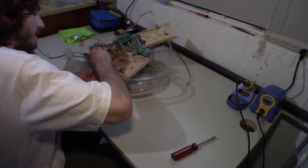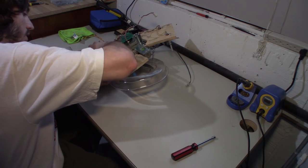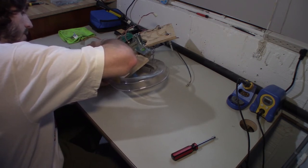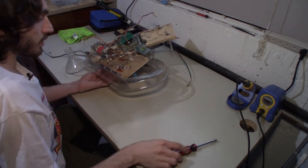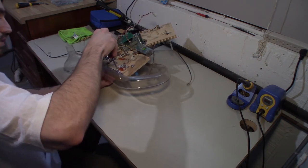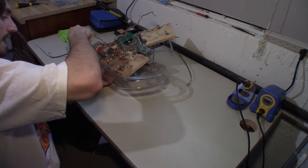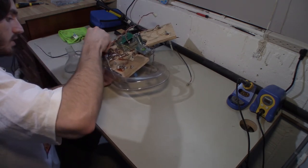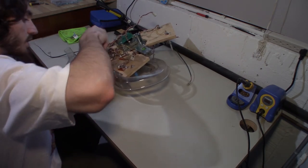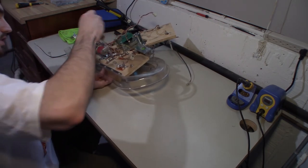And with all these ramps, I cleaned them all, washed them with soap and water, and then cleaned them and polished them with some Novus 2. So they're all in pretty good shape now. They aren't perfect, but they look pretty good. And the biggest thing here is you want to make sure your ball guide, I'm holding it underneath the playfield, is up against the top of the playfield. So I'm pushing it against the playfield here. And just slowly tighten your screws here.